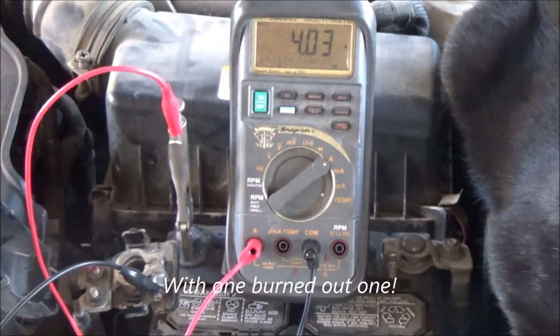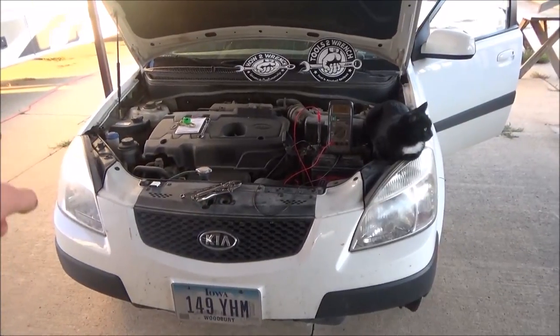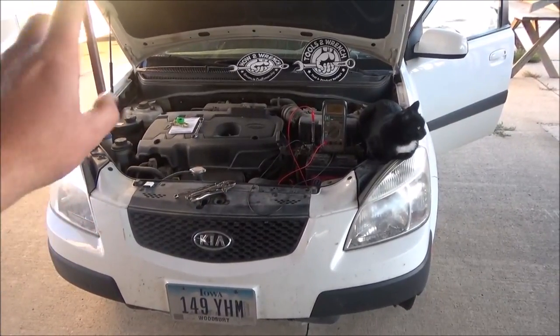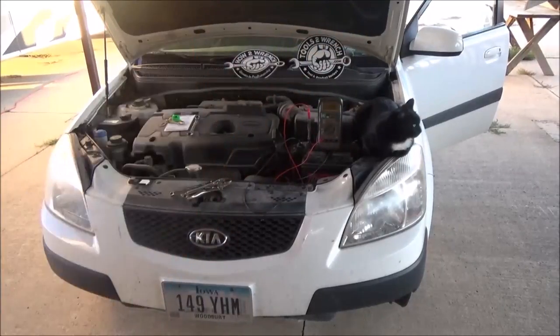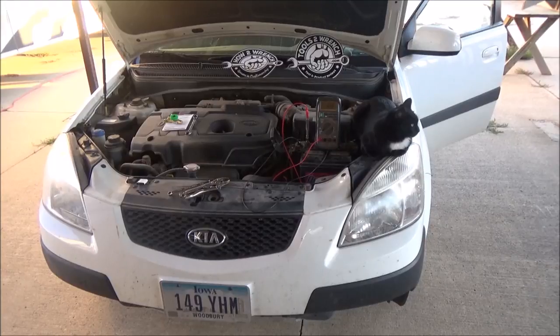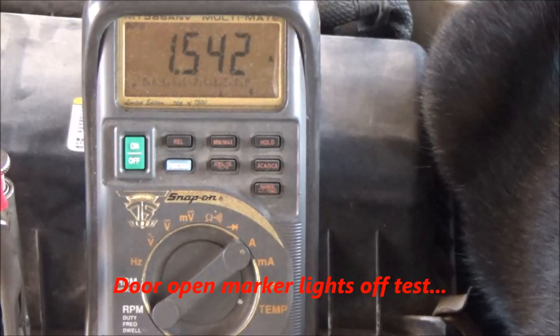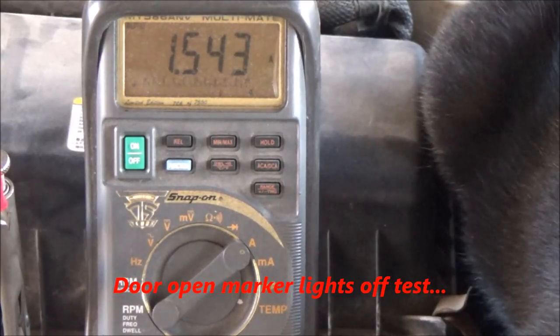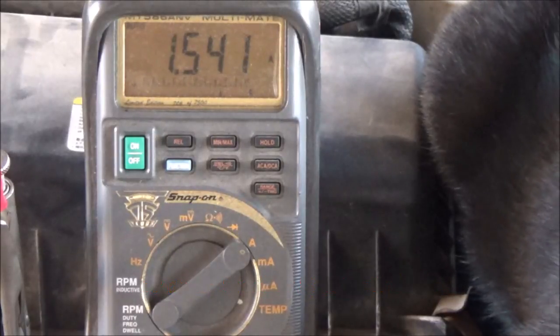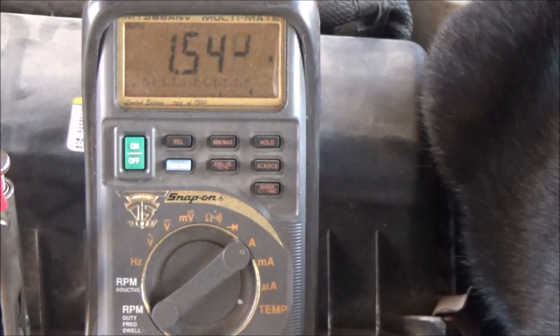That's just the parking lamps and it jumped up to 4 amps. So that 4 amps is being drawn just by the one parking light in the front and the two brake lights. I do have the door open, so the interior dome lights are drawing as well. This is a no-key-on position and you can see what it's drawing. Anything drawing right now totals 1.54 amps. To know exactly what just the dome lights draw, I'd have to disconnect everything else by pulling fuses.